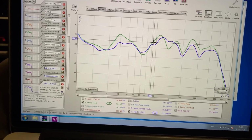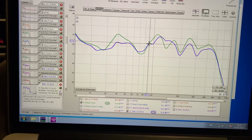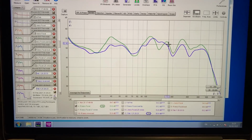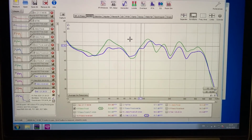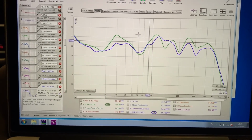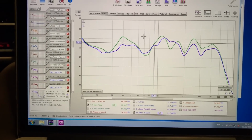That's your biggest problem. As I told you, the only solution I can imagine, and I said it even during the process of doing everything, probably even before we started, is to cross the mid bass underneath the seat at 80-90 over there, because it's kind of functional between 80 and 170, and then have the front sub fill the rest to get proper musical bass up front. Because I don't want to spend 2-3 days building something underneath the seats, and then it's not going to make a difference. It's not the effective way of doing it, I don't think. So it's up to you. I think you will only see this video tomorrow, but tomorrow morning, drop me a call.